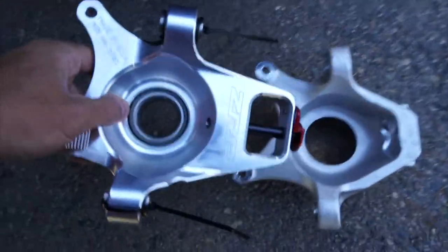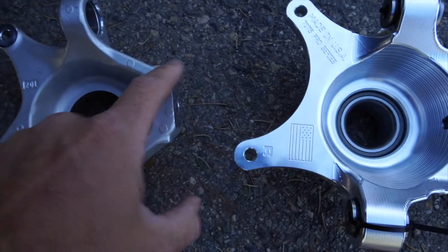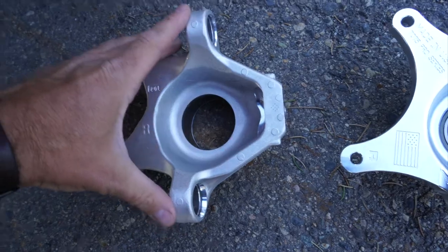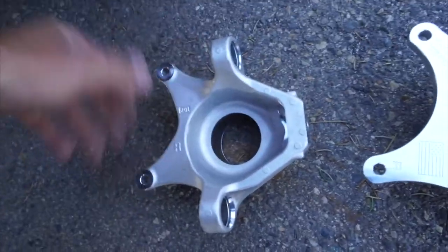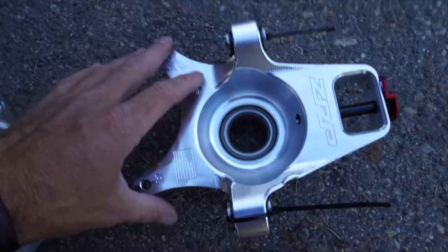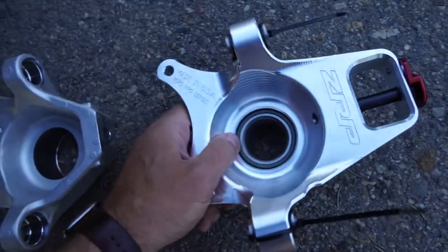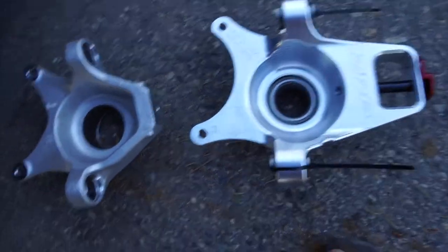Just look at the difference here — double shear. If you've got a machine prior to 2022, Can-Am fixed this problem in 2022. You can actually buy the rear knuckle from a 2022 for about 99 bucks per side — so say 200 bucks, plus you've got to get all the bushings and everything else, so you're going to be into it like $400. A pair of these ZRP knuckles are going to range between $1,600 and $2,000 to get this full billet, super strong — none of this pot metal. These things are dense, pretty awesome, lots of adjustment. We'll be able to really dial this thing in and it pretty much just pops into place.